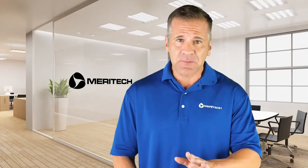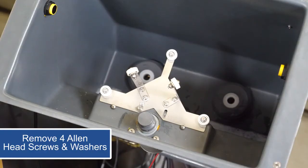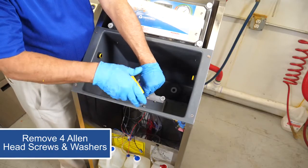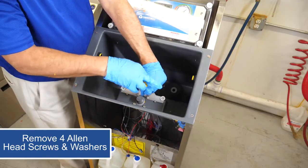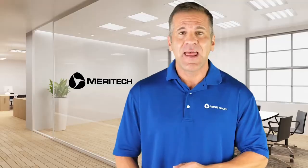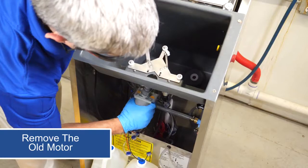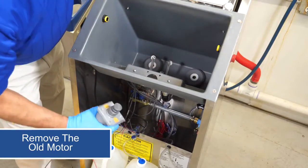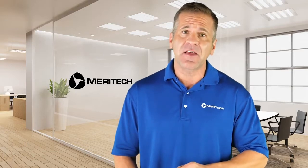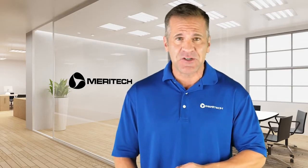Next, we'll move back up to the top and remove the four Allen head screws and washers and set them aside for use on the new motor. Now simply remove the old motor. Be sure and clean the inner and outer area where the motor mounts to the underside of the basin, as you'll want a clean surface for sealant application.